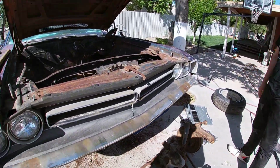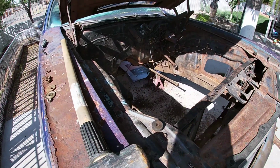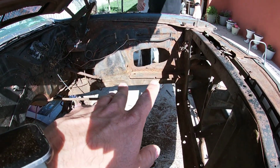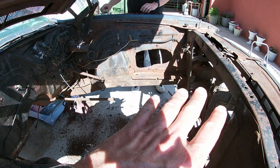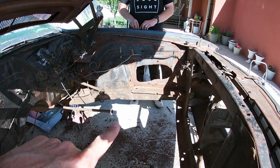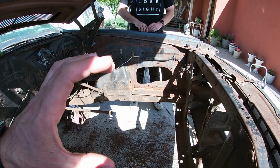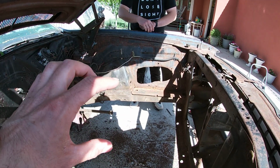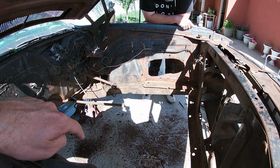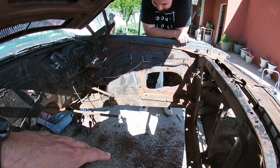We'll start bringing out the QA1 pieces out here, lay them out. And I am gonna have to cut a hole in the frame like I mentioned before to put a nut in there, and I'm almost thinking of doing that for all spots. So maybe I can reinforce the frame around the hole, but just keep a little slot so I can put a wrench in there, because all of the bolts were pretty hard to come out with the impact.